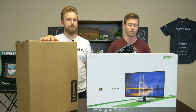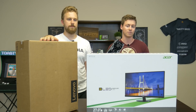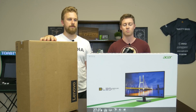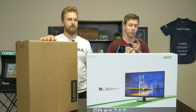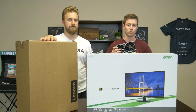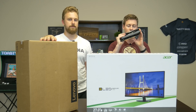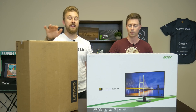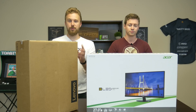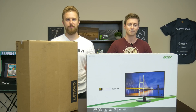This is a really low wattage build — it has a 180-watt power supply. Because there's an i3 with a 65-watt TDP and the 1650 has a 75-watt TDP, we should be pretty close as long as the power supply is 80 Plus Gold like they usually are. We recommend using the card linked in the description that doesn't require the six-pin and only uses PCIe lane power. We'll show the exact wattage being pulled from the system while gaming so you can know how close it is to the top threshold.